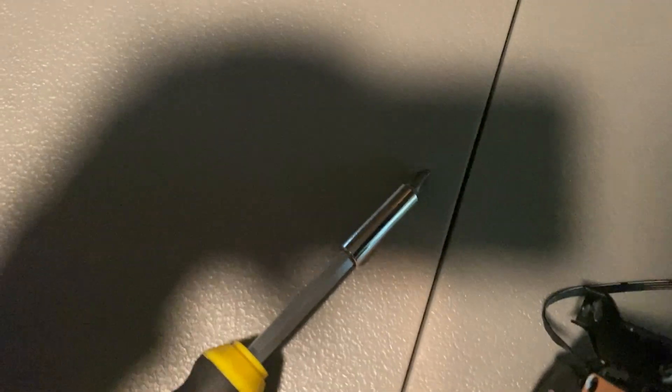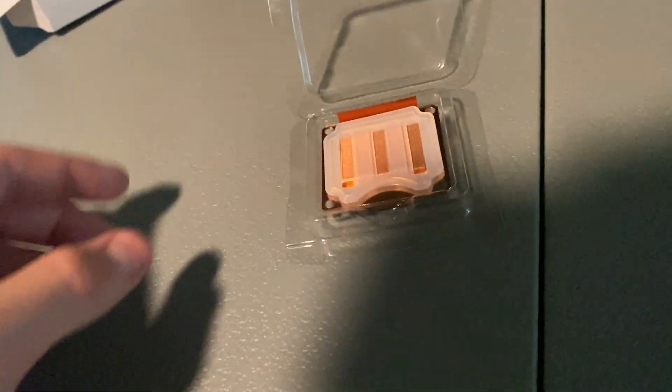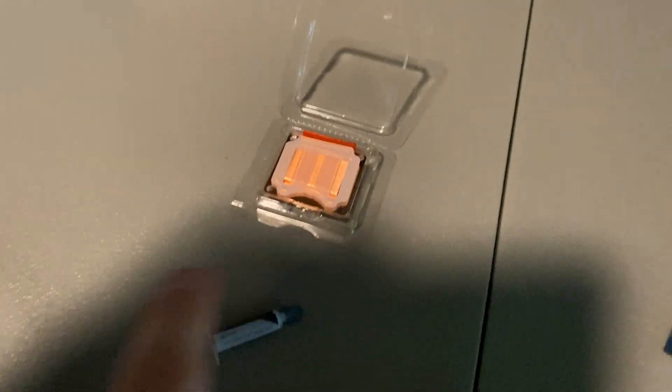Let's look over real quick what comes in the kit: two replacement screws — I hopefully will not need these — MX Clean to clean the thermal paste off your CPU and cooler (I used isopropyl alcohol and paper towel instead), MX-5 thermal paste — we're not using that, we'll be using Conductonaut like real chads — and the gasket itself. Basically, it comes upside down, so what you want to do is have it positioned so that the little curve goes down the curve on the bottom of the AIO. There's also an Arctic video you can Google.